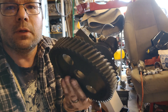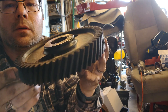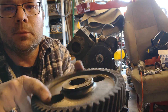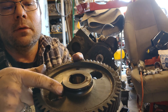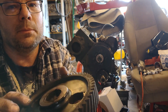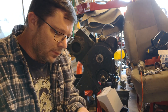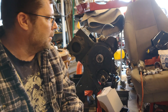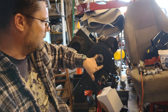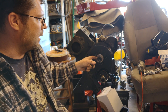So, compressed fiber — you can see on the edges of the teeth, it's easier to see on the back. On the outer side here you had a little bit more flange to grab onto. On the inner side you're right up against the boss — there's really nothing there to grab. So we were putting the teeth to go to the outside, but because it is softer it started to kind of taper a little bit. It looks like there's a spacer stuck to it, so I'm going to have to take that spacer off. If we take these two bolts out right here, then we should be able to pull the camshaft assembly out.